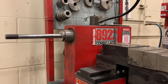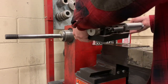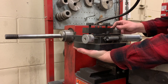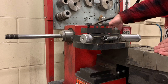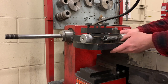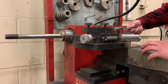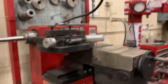The first thing we've got to do is put our cutting bits on. This is going to mount onto this stud that pokes out. Then we'll use this spacer, a washer, and a nut, and get that tightened down. I usually keep the back side of this flush with the front of the head assembly so I can drive it in far enough to make my cuts. As far as lateral adjustment, I keep it right in the middle. I can always change it later, but that's where I begin.